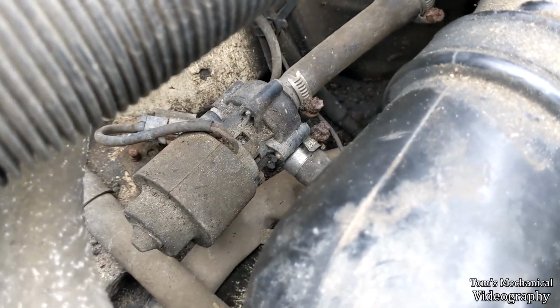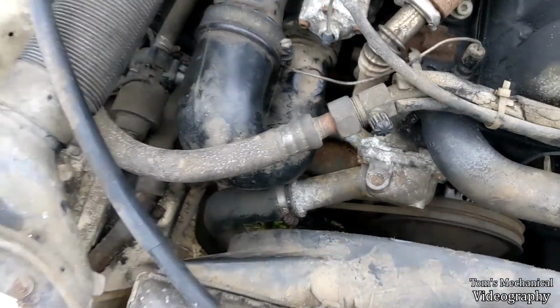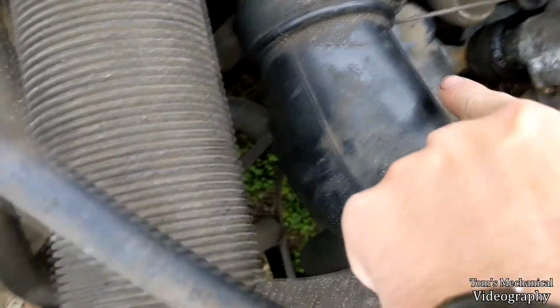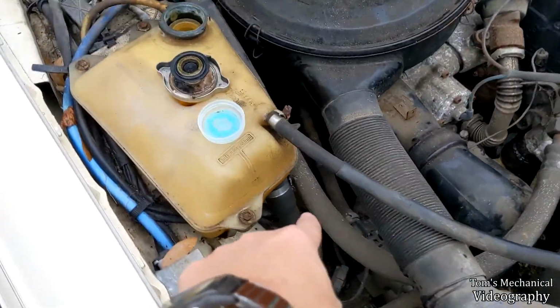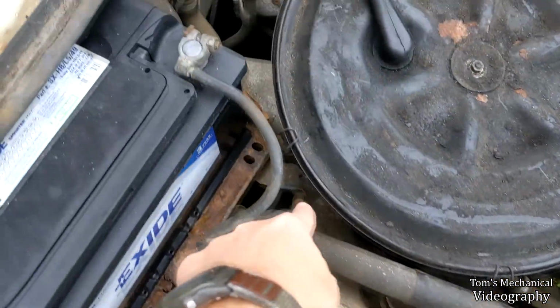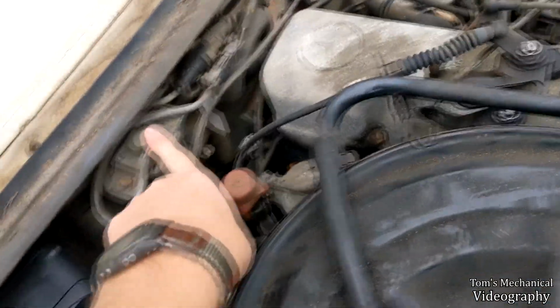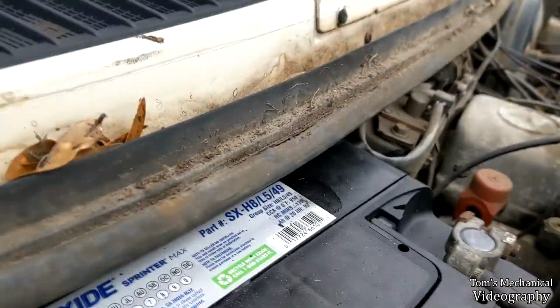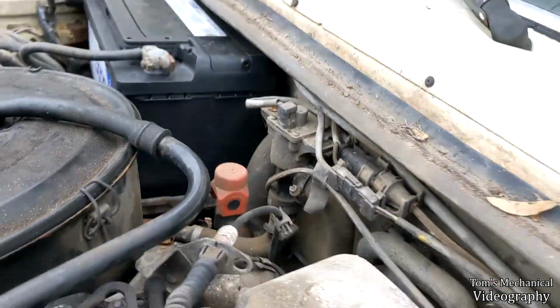And I learned that this has an auxiliary coolant pump that goes to the heater core, and I bet this is borked. It siphons off from down here at the outflow for the water pump and goes this way, back yonder, up, over, and then up to this, which I'm assuming is the climate control switch. And I'm wondering if there's a port in there that goes into the firewall or not. From what I can see, it looks like it doesn't.